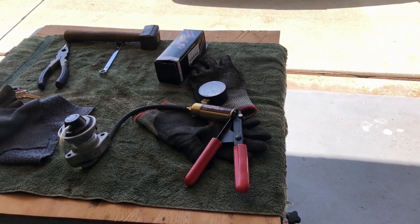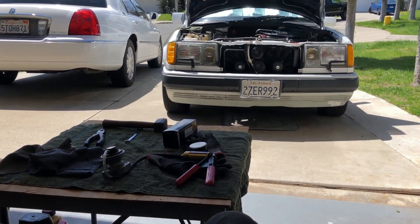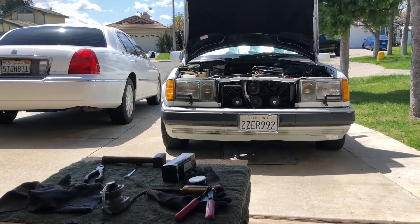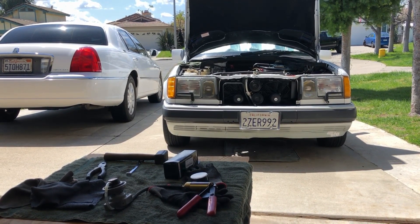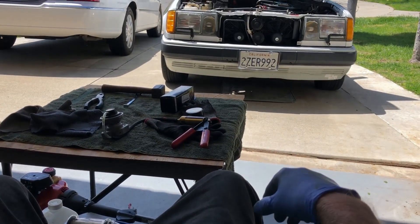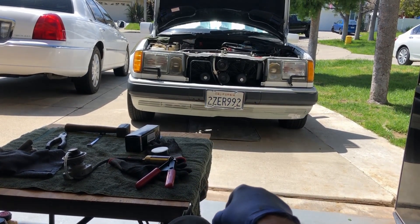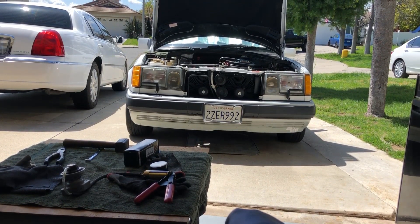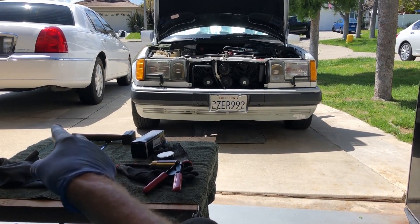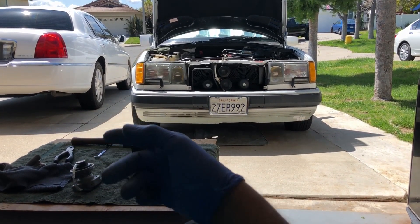Looking on Benz World, there's a million posts on EGR valves. My car wouldn't pass emissions because of this, and even those guys were saying that thing is so expensive. Some people do a bypass where they just block it off, especially the diesel ones. On these years of Mercedes diesel it's all over YouTube - EGR delete. The diesel ones get really sooty and clogged up, probably makes the engine run poorly. This is basically just carbon buildup.